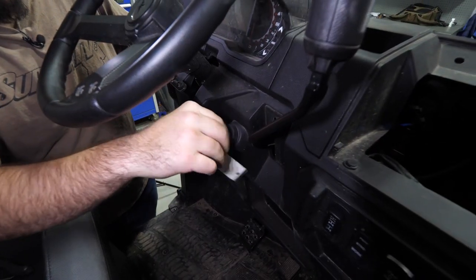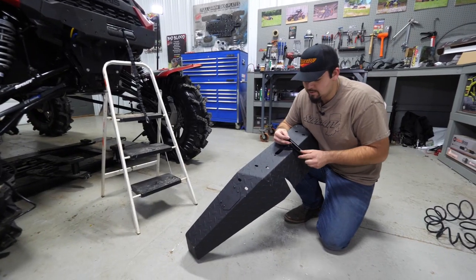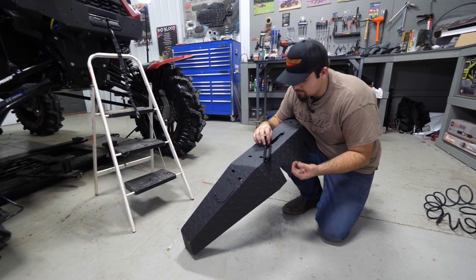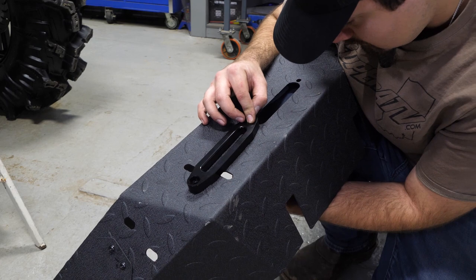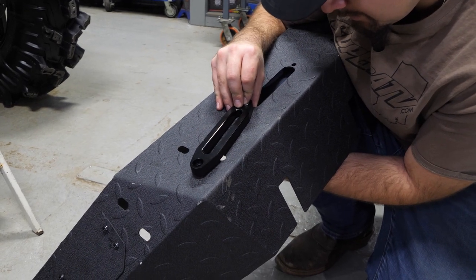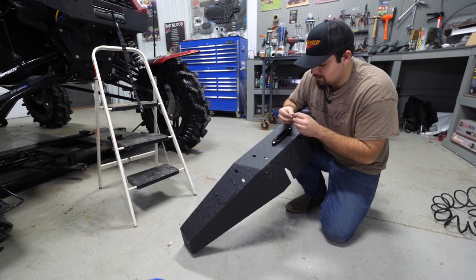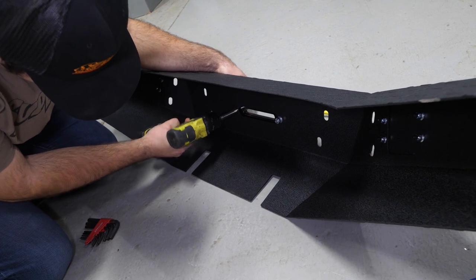Now that we've got our keyed-on power source, we'll go inside the machine, turn our key on, and make sure that our winch works. We're going to finish the installation by installing our bumper. We'll grab our fairlead out of the winch kit — with the hardware you'll have an Allen-headed screw, two lock washers, two flat washers, and two nuts. Install it flat washer first, then lock washer, then nut. Go ahead and tighten this hardware before we put the bumper on — stick an Allen wrench on one side and fully tighten it from the other side.